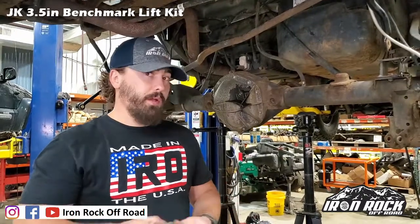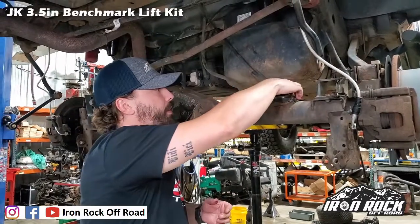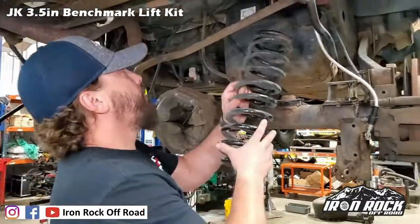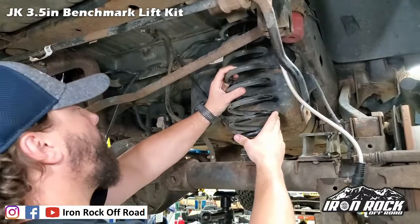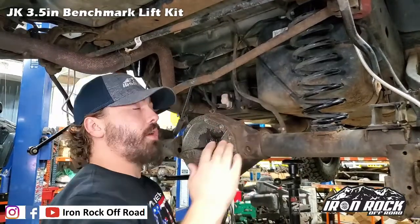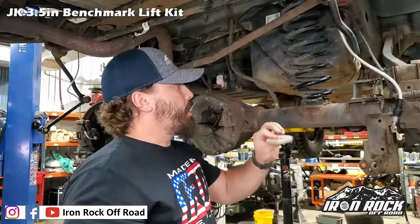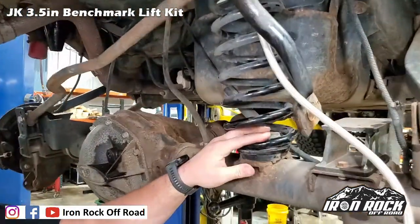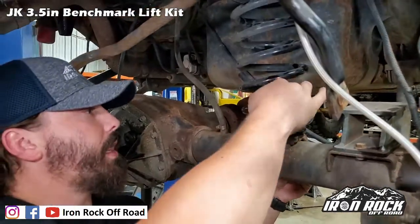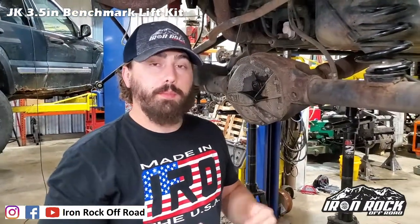Put on our optional coil correction pad — check our other video for more on that. Guide the spring right over the cone; it's loose but won't fall out, and the cone shape guides it back to position. Get the large washer over the bottom coil, put the bolt through, find the flag nut in there, and torque it down. That concludes the installation of the rear coil spring retainers.